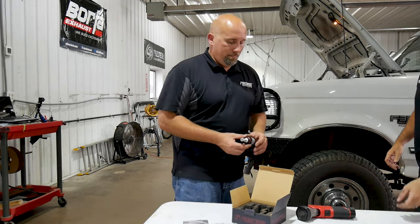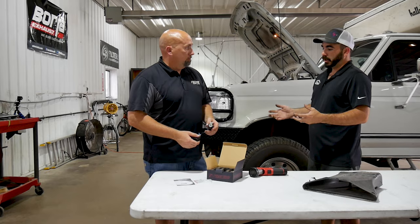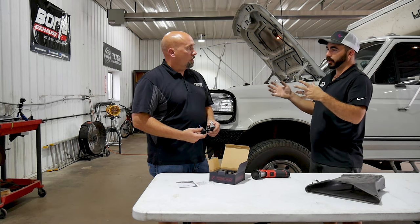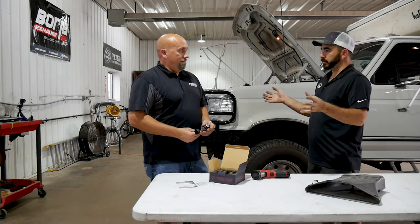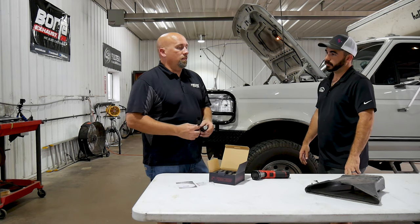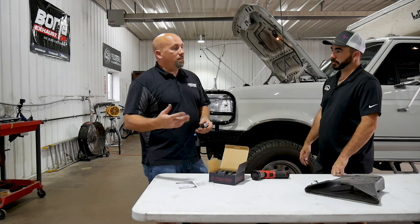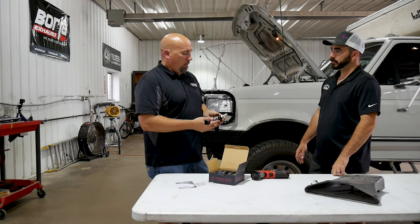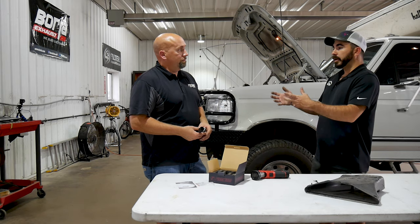Well, that's been a question. I answer the phone quite a bit, especially with tech questions, and that's a huge question I always get asked: are these going to be blinding everybody else coming along because you put them in this housing or that housing? They've watched 1,000 YouTube videos on what not to do when it comes to LEDs. There's always the people that are completely 100% against putting these in a standard housing, for various reasons, but the biggest one is light dispersion. It's blinding everybody. All I simply say is adjust your lights properly and you won't have that problem. And that's why we're here.